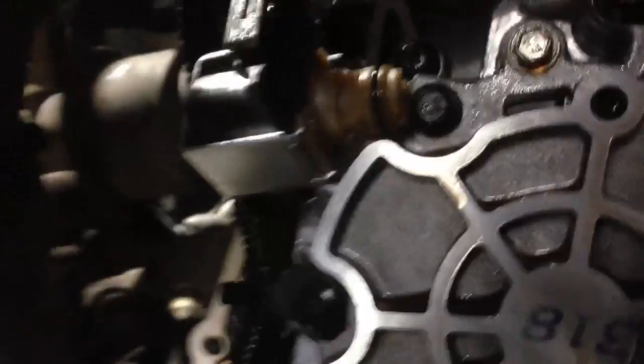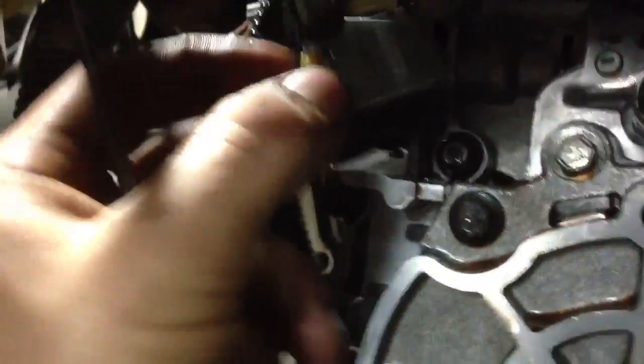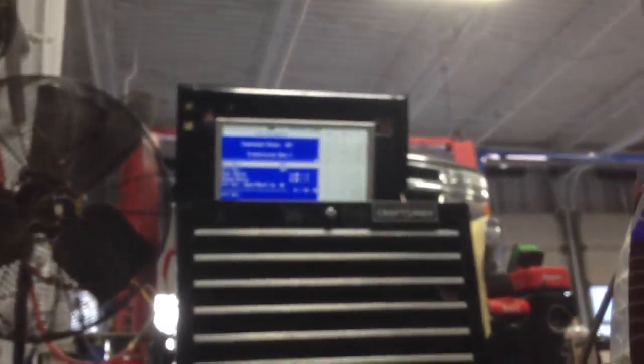So now I've got the new solenoid plugged in. Just for the heck of it, let's go ahead and test and see if we got power here on this new solenoid on either terminal. Test light illuminates — check the other one — test light illuminates. Look at that. So we had an open in the solenoid and now that's fixed. Now let's go ahead and using our Tech 2, command the solenoid on — and you can hear it click. Let's go off — there's off. Back on — click. And off — click. If you're in a noisy environment, all you have to do is put a finger on it and you can actually feel it clicking as well.